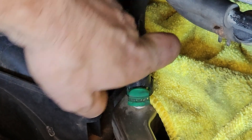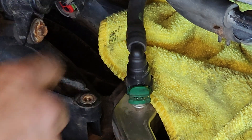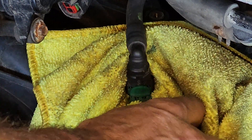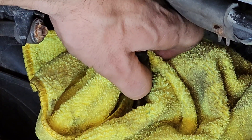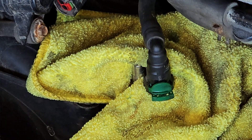Pull that out. I'm gonna get my rag and put that in around there. I'm gonna push down on this clip — with that little door open, push in, and now I can lift up. The fuel line is off the fuel rail.